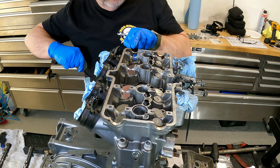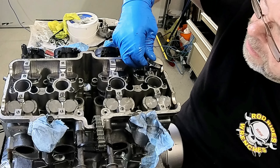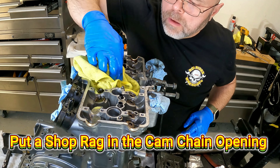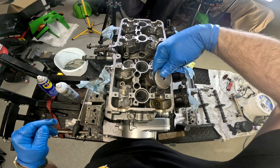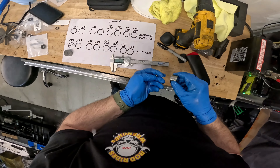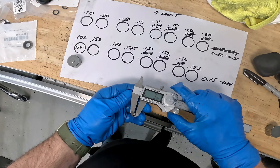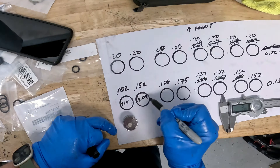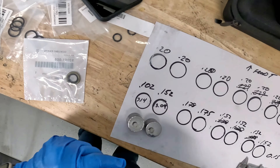Now the valve buckets can come out. To do this you need a reasonably powerful magnet to pull the bucket up and hang on to that valve shim. You want to avoid having the shim fall down into the cylinder head or worse into the engine. I almost forgot to stuff a rag into the gap in the engine where the cam chain is — hopefully nothing's going to fall down into that space. Once the bucket and shim are pulled away from the cylinder head, you can remove the magnet from the bucket and the shim should just fall into your hand. Record which valve the bucket came from so it can go back on that very same valve. I'm using a set of digital calipers since the markings on these shims are not always clear. Once I record the valve shim size, I write that down and place it along with the bucket on my record chart indicating which cylinder and which valve it was pulled from.